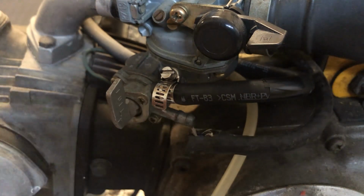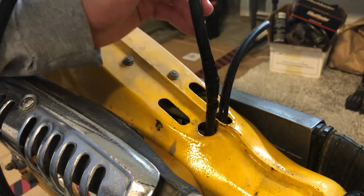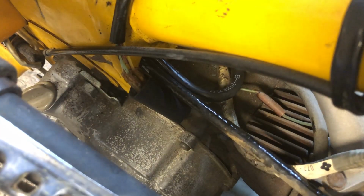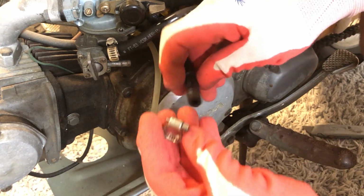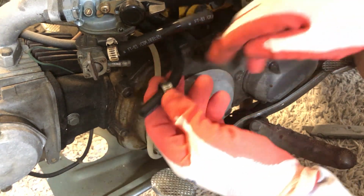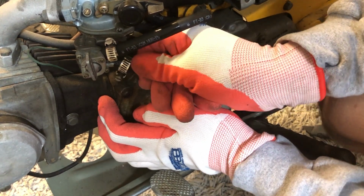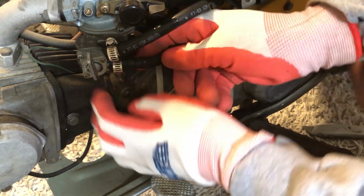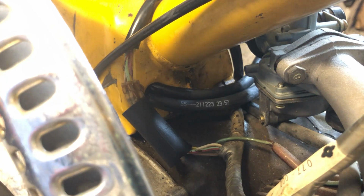Beautiful. All right, you know the drill, but this time we're gonna preemptively lube up the tape so that part slides through just a little bit easier. And the tape is through. Now, same thing as last time. We're just going to put on a hose clamp and push in the fuel line all the way, like so, and tighten her up.